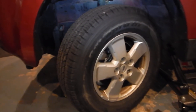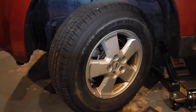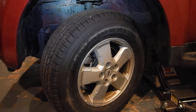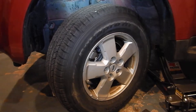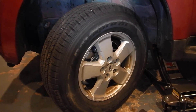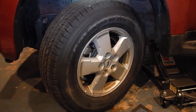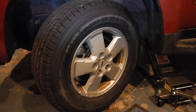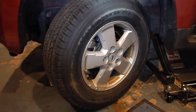If you're going down the highway and you kind of hold the wheel very loosely and your car lets say it pulls to the left — well it could be a number of things: tires, tie rods, ball joints, whatever. But if a brake is dragging, then whatever direction your car is going, that is the dragging brake. So if it drifts left then it's going to be your driver's side brake dragging, and if it drifts right then it's the right side.